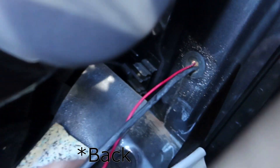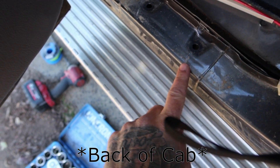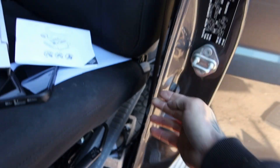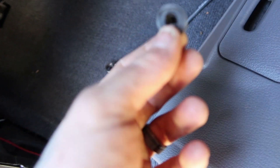This cable here I've got running through a grommet — once I do it I'll silicon it up. I've just popped the door trim off using a flathead screwdriver; you just get it under there and give it a light lever and it pops off — they're just little clips. The seat belt cover trick is to pull it from the front because you've got more access. Once you pop this side off it pops off the back. Same thing with this one — couple of clips, just gently pop them up. This one here has a little plastic bolt that goes up in there.